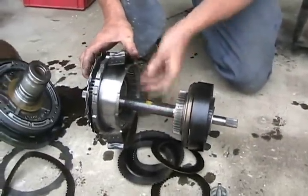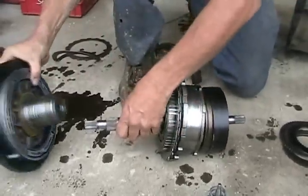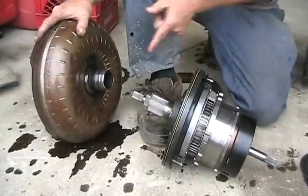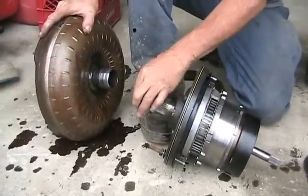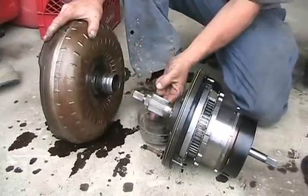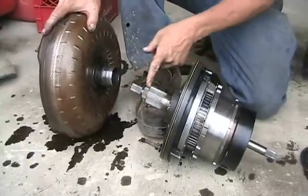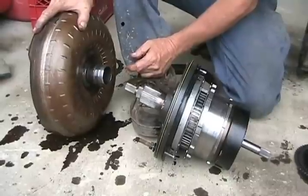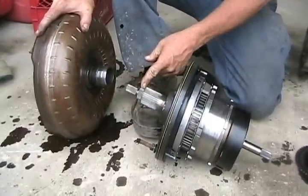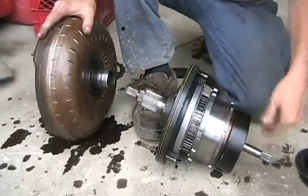This is the input shaft. The way this was assembled, this is the input of your transmission. This is the oil pump drive shaft. The torque converter always needs oil pumped into it, because if oil is not pumped into it, gravity causes it to leak halfway down to the middle and it runs back into the oil pan of the transmission. As soon as you start your car up, it's rotating this shaft, pumping oil through the spaces around here to keep your torque converter always full of automatic transmission oil. This is the stationary shaft — it just stays affixed to the transmission. This shaft is the input shaft where all the power from your engine, from the inside part of the spinning torque converter which is like the clutch, drives all these clutches and gears inside.